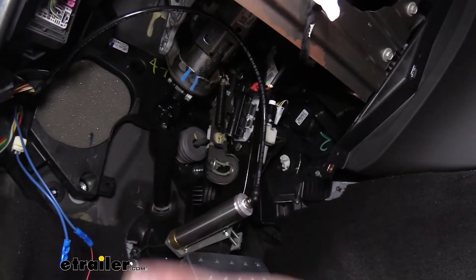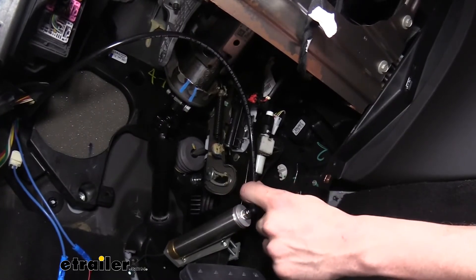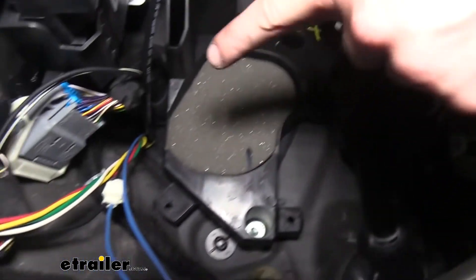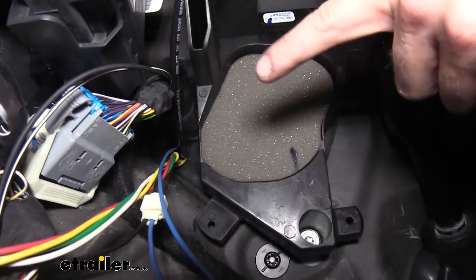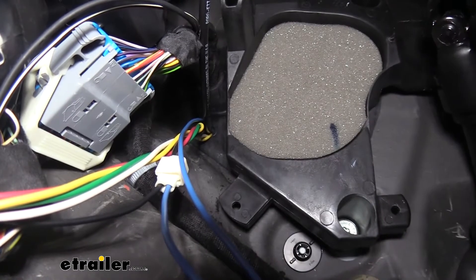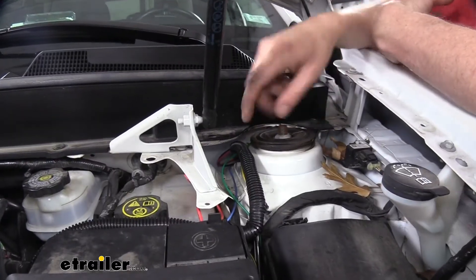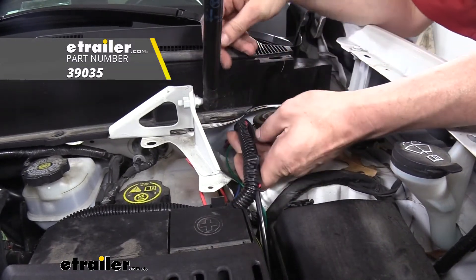Now that we've got our LED and all main components attached, we need to start hooking everything together. The airline tubing connects right here to the cylinder — poke one end in there and feed the rest out into the engine compartment. You can use it as a pull wire to help pull your wiring through. We taped our wires to this pull wire after connecting it to the cylinder, then pulled it through the grommet located just above the electrical connectors on the lower left kick panel area. We took a drill bit and put a small hole through the large grommet area there — be careful not to go too far and hit any components. A bit of soap and water can help slide the wires through easier. We wrapped our wires in conduit to protect them.